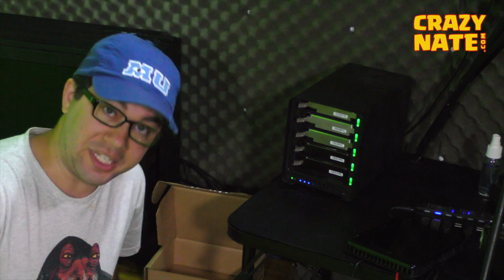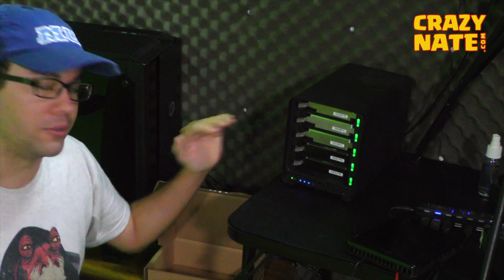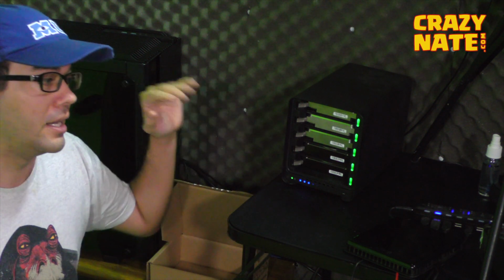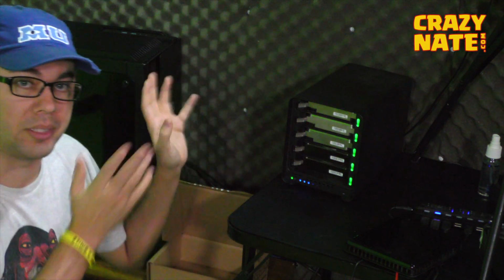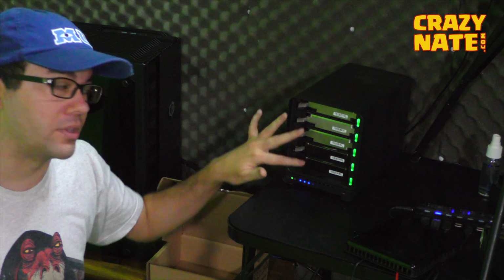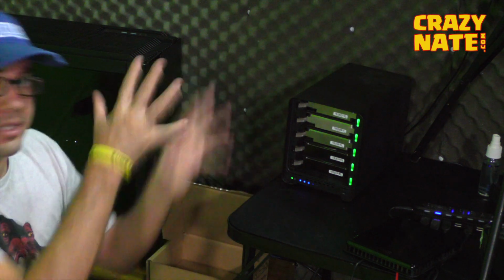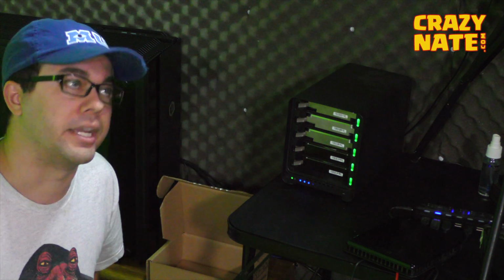This is day 3. I should point out a little note here. If you bought the Drobo brand new and you're just now starting up, it won't take this long to set up. The reason it's taken me so long is because I had 4 drives of 4 terabytes and already had tons of data on there, videos, images, you name it. So it's trying to transfer the data to the new disk and keep it on the old disk. Every time I pull one out and set it up, it has to reconfigure everything. If you're starting from scratch, it won't take this long. If I were to pull all 4 drives out and put in all 12, I would have been done ages ago. But yeah, so we finally finished.